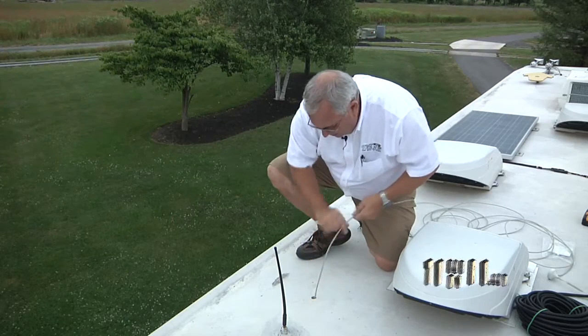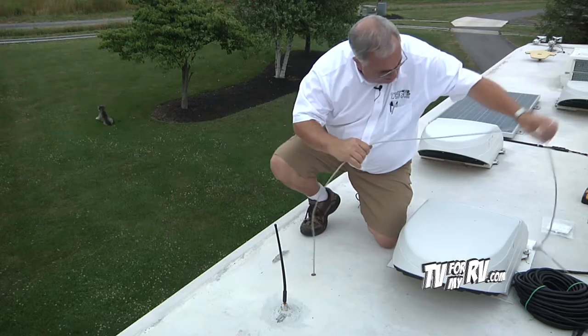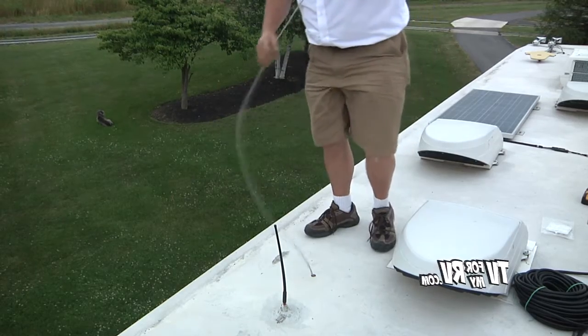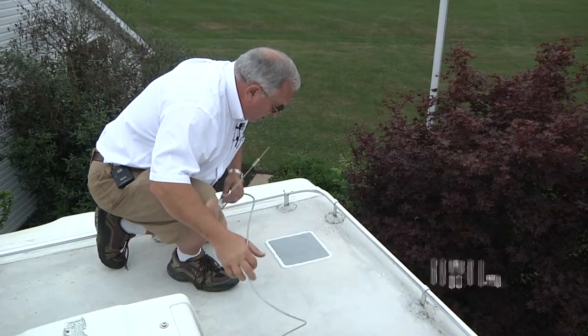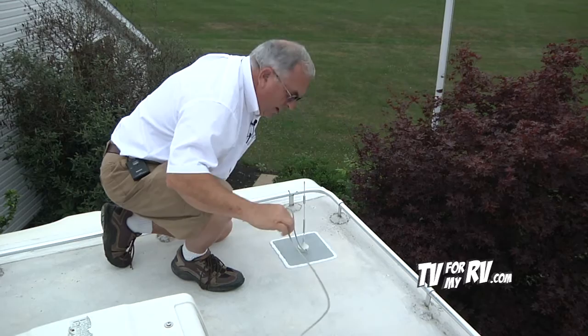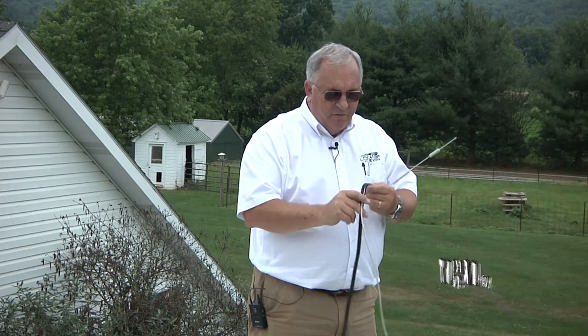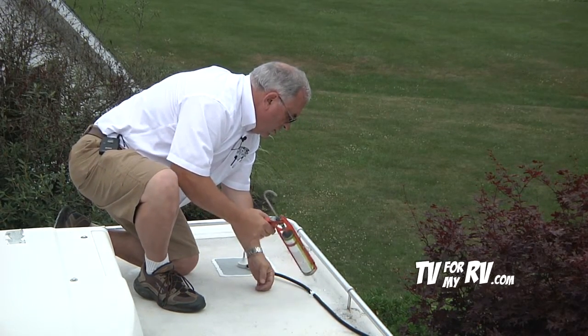We've got the outdoor antenna cable unrolled and we're ready to put it down into the compartment. Try to get as many of the kinks out as possible to make a nicer, neater installation on the roof. The die core is skinned over lightly, so we're going to put the antenna down in the middle of the plate and then route our cable up to the entry point. Even though this is outdoor-rated cable, I still like to put plastic split loom over the cables on the roof. It gives them extra protection from UV from the sun and from any potential damage from limbs dropping on it in the campground.